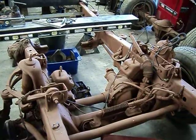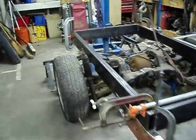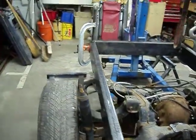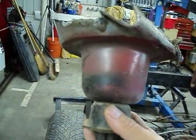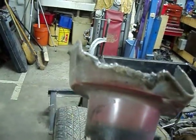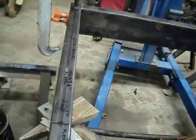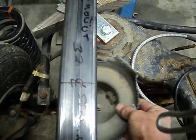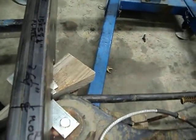I don't know how it's going to set in the back yet. It may require either spacers to raise or do the rear springs, or else cut a little bit of the coils off. What I'm going to do — I cut the old pieces out of the Thunderbird that were the top pockets for the springs, actually not a pocket as much as a centering point. These were cut off the Thunderbird and I'll trim them off and make them even. They'll go up underneath the frame here — a quarter inch thick by 15 inch piece that goes along in here, and it'll have triangulated braces on it.